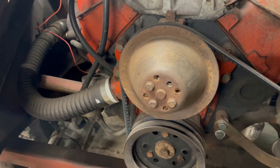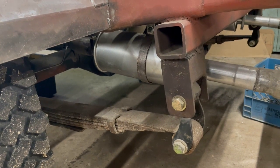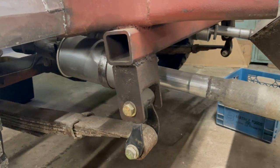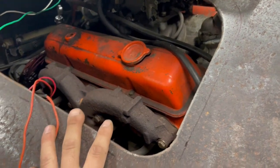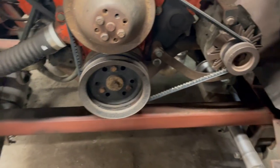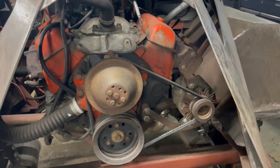The other thing we're going to attempt to do, and this is something that came up and you just don't really think about it, is the exhaust system, which I was never really happy with. This was an interim measure, but what we noticed is that the engine deck was extremely hot. The steel was actually hot to touch. A lot of heat was rising up. You can see those two mufflers are right under, and I think the heat was rising up, getting trapped in there, and obviously that's not a good situation for cooling.